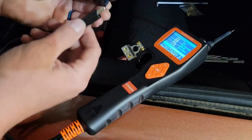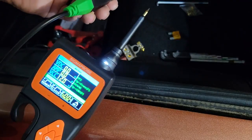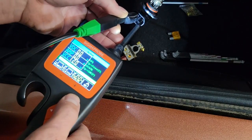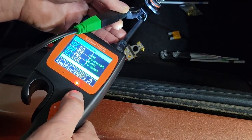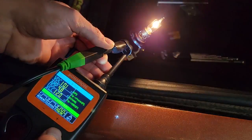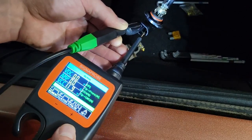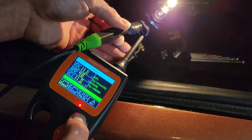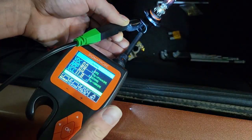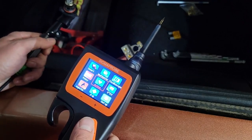Going into the activate menu, you can see you have moment mode, and you can adjust settings, then select tip for power — tip down means ground. You have moment, latch, and pulse modes. I connect my alligator ground clip to one post of a headlight and press and hold the up button to supply power to the probe tip on the other post, activating the pulse. You can then switch to moment mode and hold to shut it off.